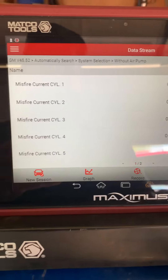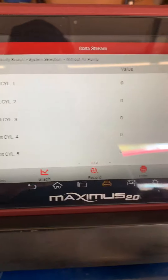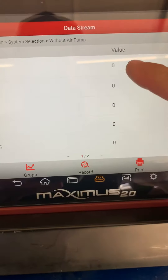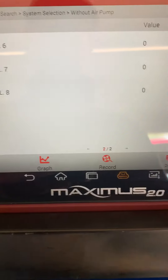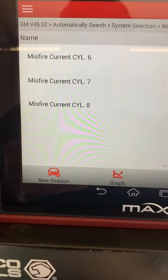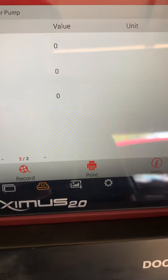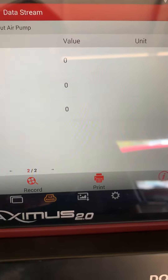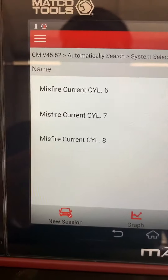I have my vehicle running right now and I've got no misfires. If I had any misfires it would show right here and how many I had. Let me swipe the screen to the other end — there's six, seven, and eight, and there's no misfire. So the ignition system seems to be intact and working in really good order.